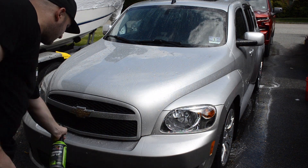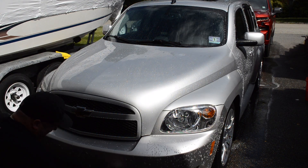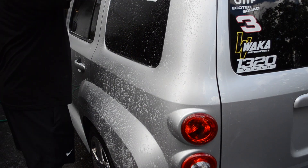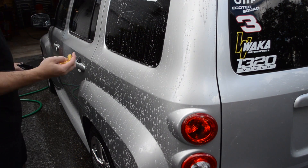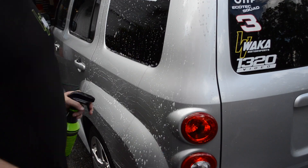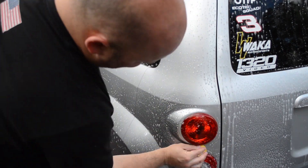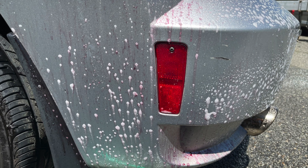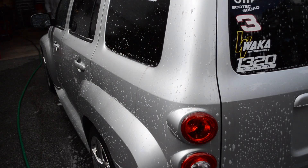I'm going to hit the entire car with a clay bar. The car has not been clay barred before — it was better in certain areas than I thought and worse in certain areas. You can see the purple is the iron being taken out of the paint. I hit the panel with the iron remover, and as I'm going over it with the clay bar it's still de-ironizing while I'm still clay barring. Here you can see the purple dripping off the bumper, off the window. Once you clay it down, you rinse it off — smooth as glass.